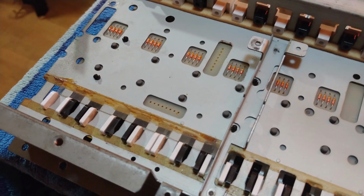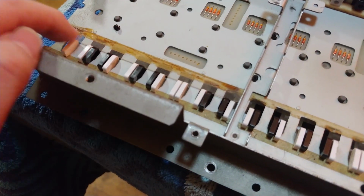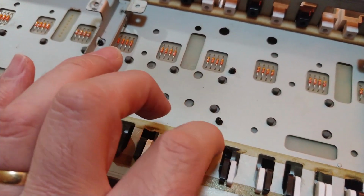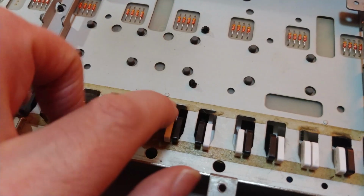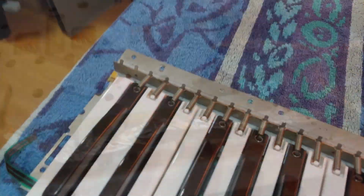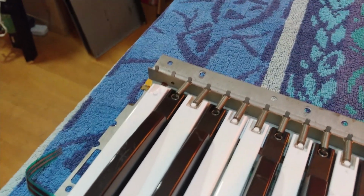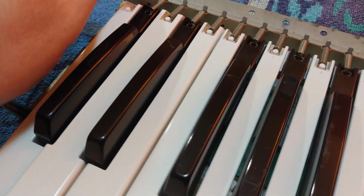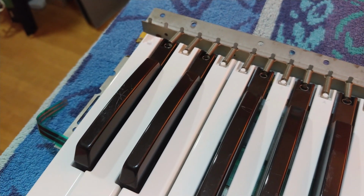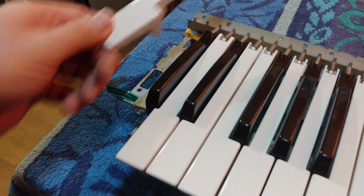There's a couple of things you have to do to get the keys on and off the keyboard, and one is there's this plastic strip which goes here, and that stops the keys slipping forward, which is how they come out. I can see it's actually missing here, so I might put one in afterwards. It doesn't matter if the plastic strip isn't there, because it's not that actually fixes them in place. Okay, so if I turn the keyboard over, then you can see I've already removed a spring here. I'm going to replace this key. It's the spring that keeps them there, and so you need to remove that plastic strip in order to shift that backwards so that it then lifts out. Okay, the strip's removed, and you pull them forward to get them out, and that's how it's done.